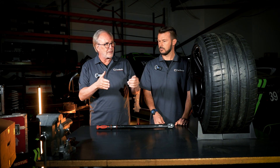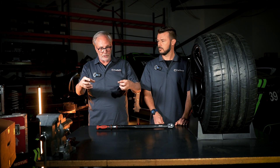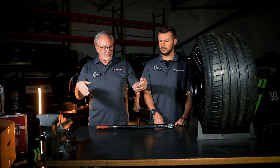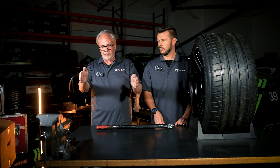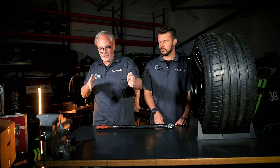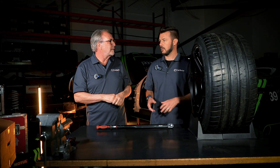If we get too much, the car darts around and is very uncontrollable, especially if you leave all the rubber in the suspension system because the rubber has play. You get wind up with toe changes in the back from the rubber flexing and caster changes in the front from the strut rod changing, and then the car will dart all over the road under braking or turning and make the car very hard to drive.